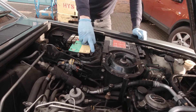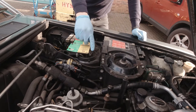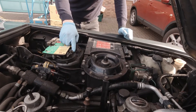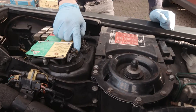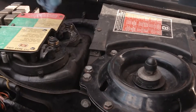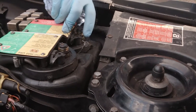When you get the proper stuff and the spout, you insert the end of the nozzle in there and twist it in and it locks in. Then you turn the bottle upside down and squeeze it in until there's a little green float that will rise up to the top of this sight glass here when it's at the right level. So when you see that one is obviously a bit low, that needs topping up. This one here — you can see there's actually a green float in the viewing point, so that one doesn't need topping up.